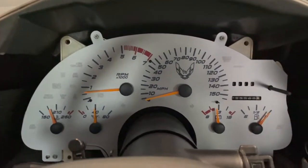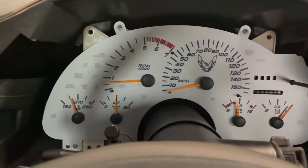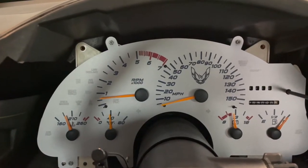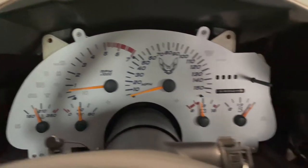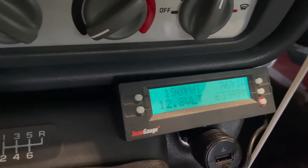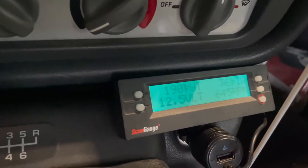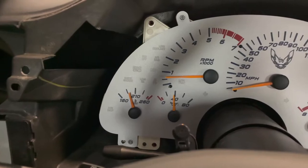All right, so I'm at the point of getting the gauges or the needles back into the proper position. If you took a picture with the engine running, obviously before you took anything apart, that's what I would use for your comparison. What also helps is if you have access to a scan gauge, something you can pull the stats from your OBD2 port. So you can see, like, water temperature, 190, make sure that lines up with what you're showing on your needle there.